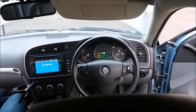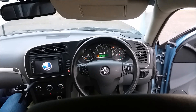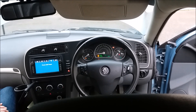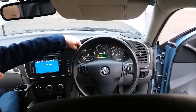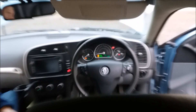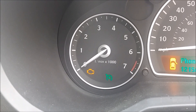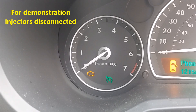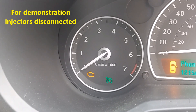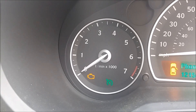When I crank the engine, as you can see, it isn't starting. The simple and easy way to tell if it's your crankshaft position sensor giving you the problem is to crank it over and carefully watch the tachometer. I'm cranking the engine over now and you can see the tachometer is firmly stuck on zero. If it was another problem causing the engine not to start, you would see the cranking speed displayed on the tachometer — cranking speed being around 200 RPM usually.